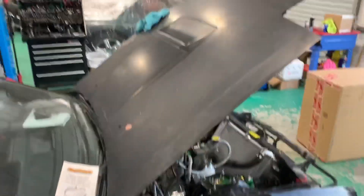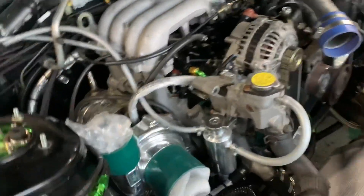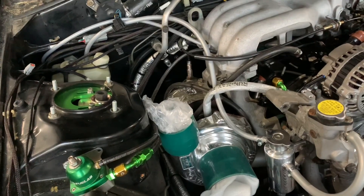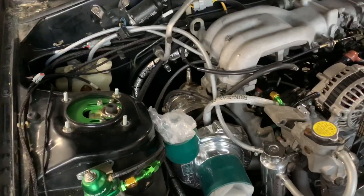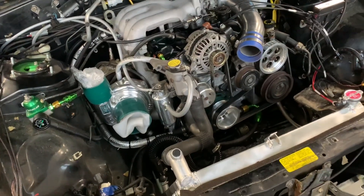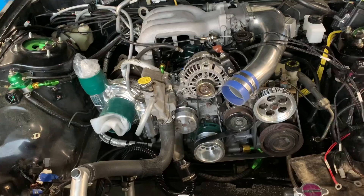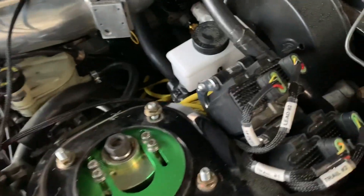We're also a carrier for Reinhardt Takumi exhaust, so it has a Reinhardt Takumi exhaust on it — really clean. It's got a nice cage in it, and overall it's a really clean chassis. It'll be running the turbo two hood, which looks flawless. Engine-wise, it's a big HKS T51R turbo, so it's going to spool really nice. As far as the power band up top — mid to top range — it'll have a nice spool. It's an old-school turbo but I want to break this engine in with it, enjoy a really crazy top end and mid-range, and that lag in spool will help me get out of corners without spinning too fast.